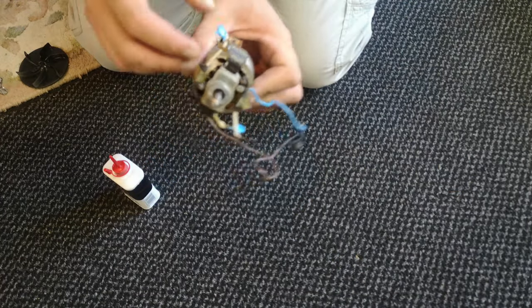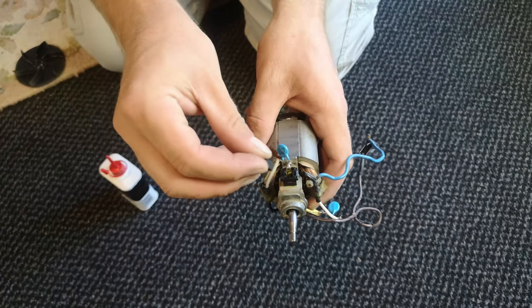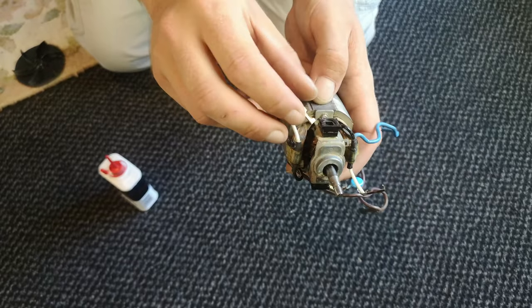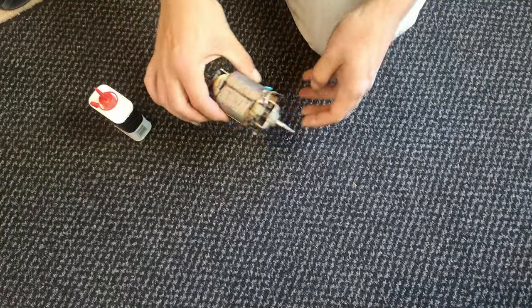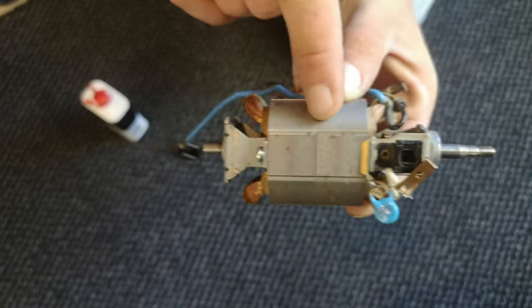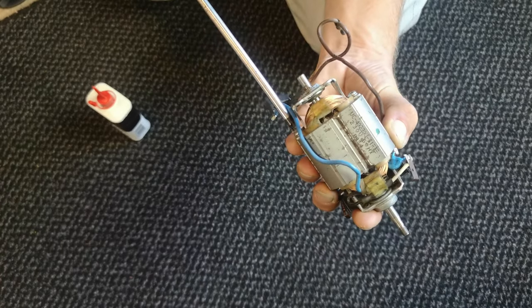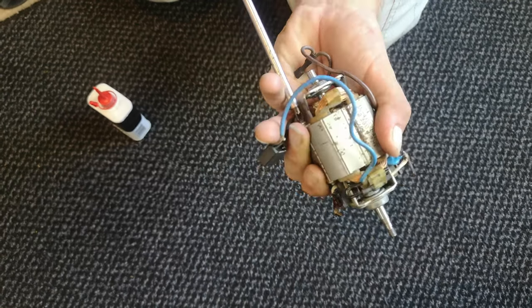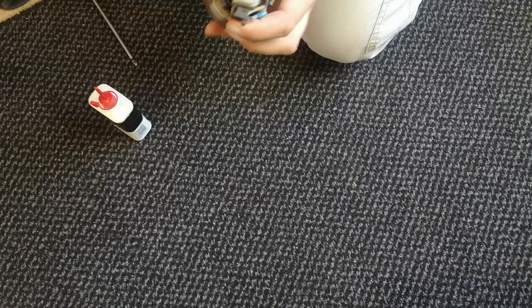The next thing is to figure out this carbon brush wiring. I think one piece of metal goes in there, then the carbon brush locks it into place. This is where the benefit of recording or taking photos of everything comes into play. I loosened these screws - those two tabs just slot in there - so I can hold it quite nicely with my fingers and just tweak the screws back up. Not too much. Oh look - that's how we can tweak how much the motor spins. That's going to do it - one nicely spinning motor.